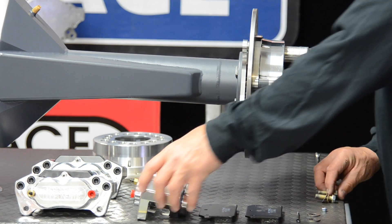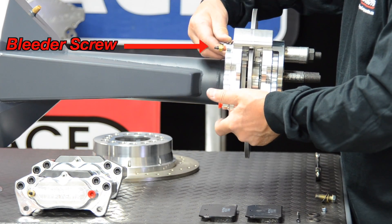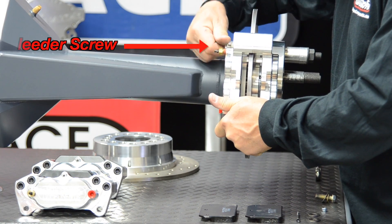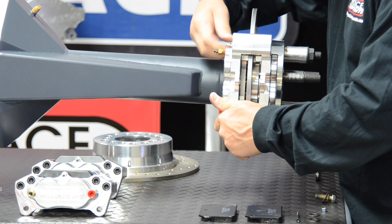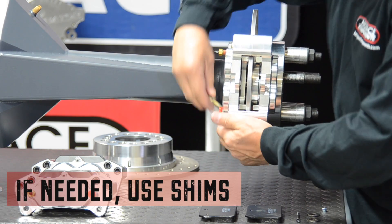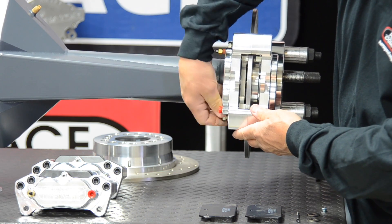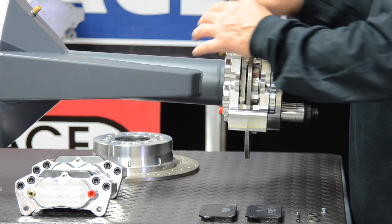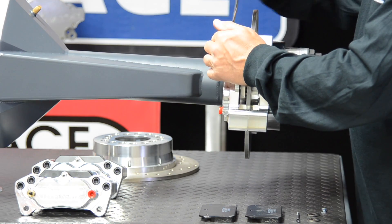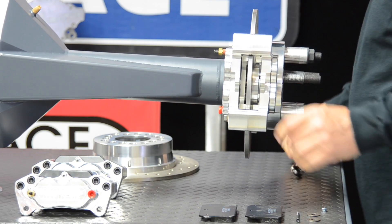At this point, we are now ready to install the brake caliper. With the bleeder screw at the top position, slide the caliper over the rotor, noting where the parting line of the caliper is in relation to the center of the rotor. Shims may be required between the caliper and mounting bracket to center the caliper on the rotor. Bolt the caliper to the bracket with the 3/8-24 x 1-1/4 hex head grade 8 bolts, using the split ring lock washers and shimming as needed.